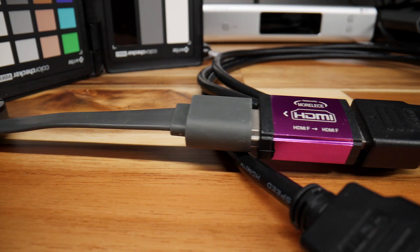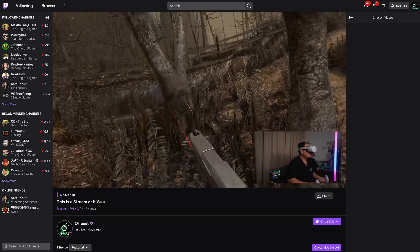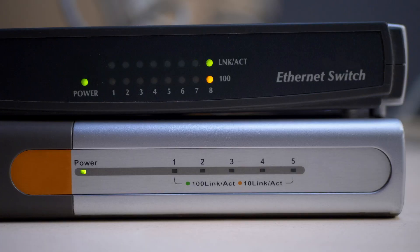With streaming there's always issues that come up. If your Chromecast can't connect to your Wi-Fi or the devices don't see each other, it's often because the Chromecast is near a bunch of cables that interfere with the Wi-Fi signal — try using an HDMI extension to position it higher. You may also see some artifacting or pixelation when Chromecasting; that's normal due to the connection between the two devices. If the signal keeps cutting out, make sure the Wi-Fi signal between them is strong and they're not too far apart — if they are, get a bridge or a router.